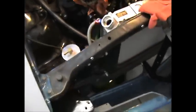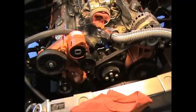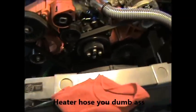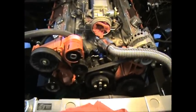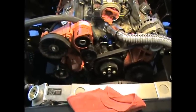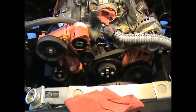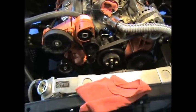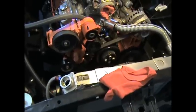So I'm going to start stripping the front of this car down. As you can see it's draining the antifreeze. I've got the upper radiator hose off lying here and we're just going to let it drain for a little bit. I'll take the pulley off while the serpentine belt's on holding it tight, and then we'll take the serpentine belt off.